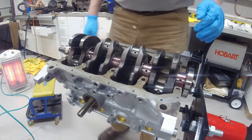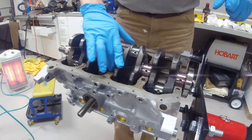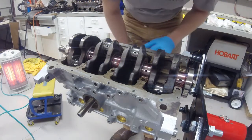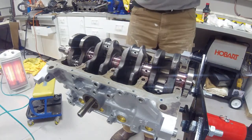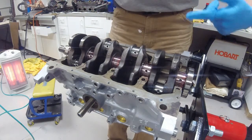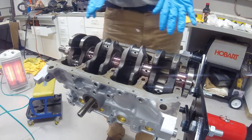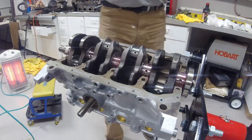It is now time to install the crankshaft very carefully into the bearings. In my previous attempt, I had tested that the crankshaft rotated, which basically allowed all the bearings to slide out. Do not rotate your crankshaft at this point as your bearings may turn out if you rotate it a certain direction, as the tabs will not lock in. Now it is time to assemble our caps.